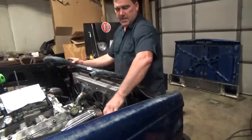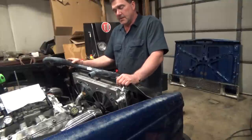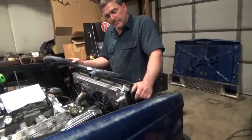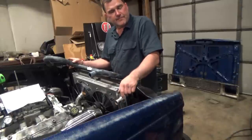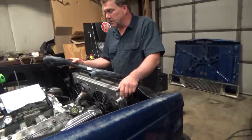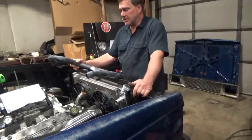What I'm looking for is a nice tight bend off the radiator, then I'll use a union and make a nice tight bend back into the water pump. That gives me clearance for my exhaust pipe. I'm going to put an elbow — which is chucked up in my bandsaw that I destroyed the blade on the other day being too aggressive on stainless steel. Hopefully new blades will be here tomorrow. Ultimately this is going to be a twin turbo car down the road, but for now we're just going to run them up and forward.